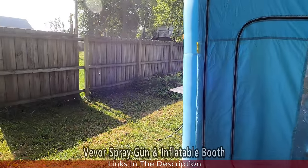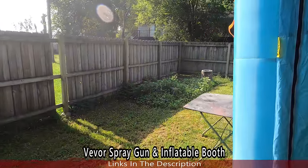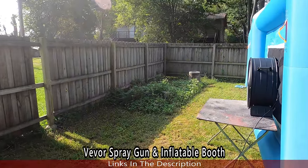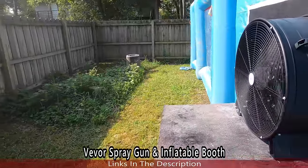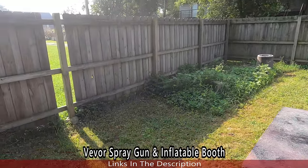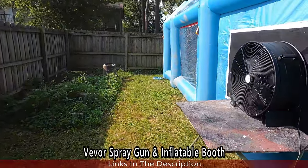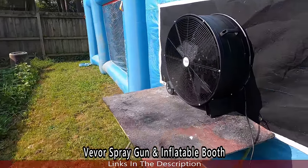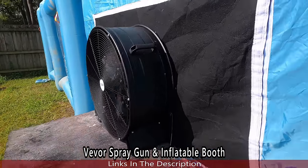Let me show you the fan. It is pulling the overspray out. Not sure if you're seeing it, but it's pulling it out. My little setup for now. See.